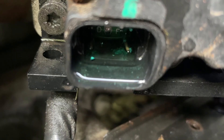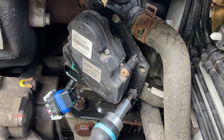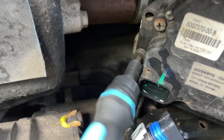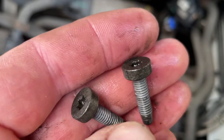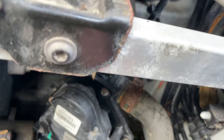It's leaking from the electric bit, so it's really bad — that will be corroding. Let me get these torx bolts off. You've got to be very careful you don't drop them down there. That's the only screws holding it on — it's just held on with these two torx bolts. Now you can see it's loose, just held in by the pipes themselves.